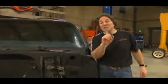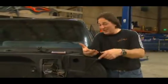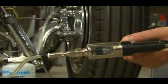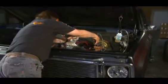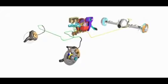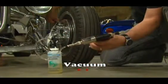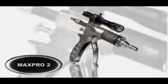The good news is this is something one guy can do — no more Cousin Eddie. This system works great on any small hydraulic system: brakes, clutches, whatever you're working on. On top of that, you can also do any other type of bleeding, like vacuum bleeding, which draws fluid down through the system and out the bleeder valve; pressure bleeding, which injects pressurized fluid at the master cylinder and forces the air down and out the bleeder valves; and bench bleeding, which allows you to remove all the air from a component before you install it. With some brake systems, using a combination of bleeding methods will give you the firmest pedal — that's why the Max Pro has been designed to perform all methods of bleeding. So no matter what you want to do, you can do it all with this one tool.